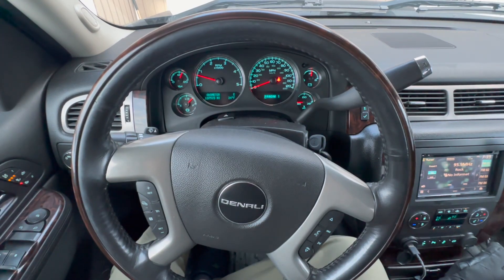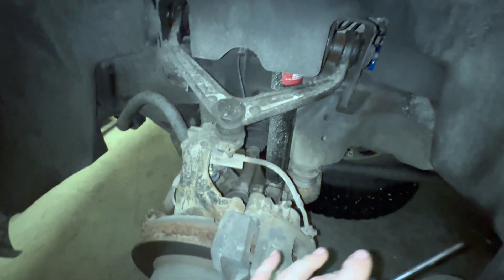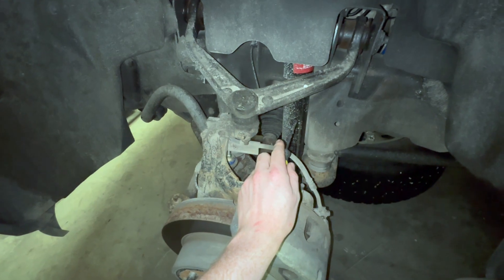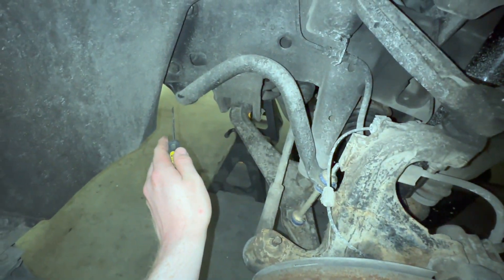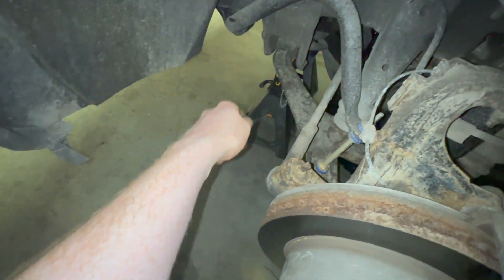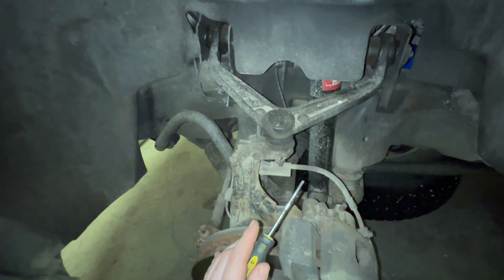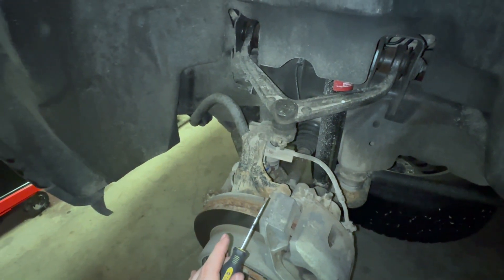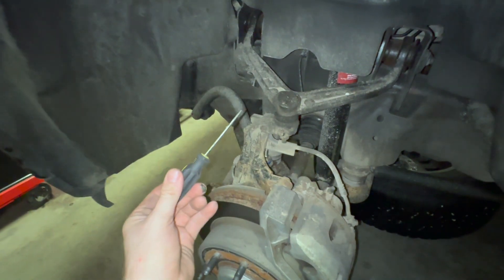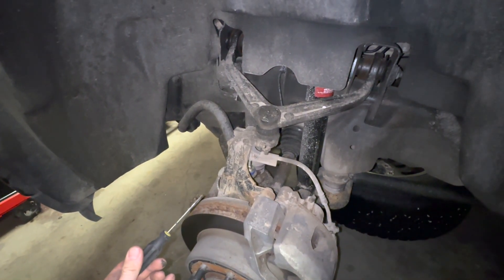Let's pull in and take care of it. I went ahead and took the tires off both sides of the truck — there's also a tire underneath just for added precaution. Looking underneath on the driver's side, I previously replaced the shock, sway bar link, and sway bar bushing — all Moog products. Along with that theme, I'm also doing Moog products for the upper control arm, inner and outer tie rod, and the pitman arm and idler arm on the steering rack.